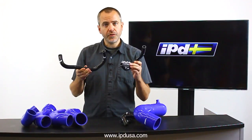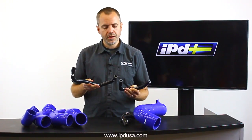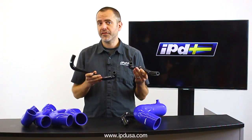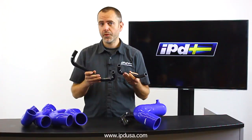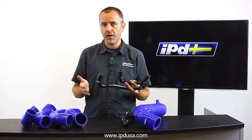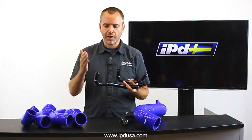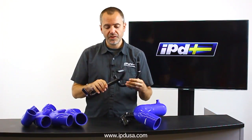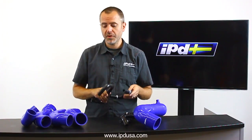This one's also neat because you can finish that full cooling system kit — these are heater hose kits for those. Now I know what you're thinking: these don't have the brass fittings on them. But these are designed to work with the OE style brass fittings. It does require a little alteration of your old hoses you're taking off, but once you do that it's a real easy thing — cut the brass pieces off, hose clamp them on here, all done. And you've got a very HD long-lasting matching silicone heater hose kit.